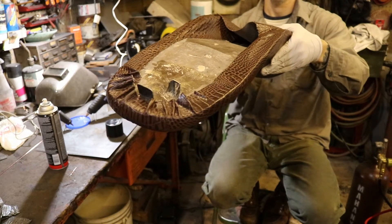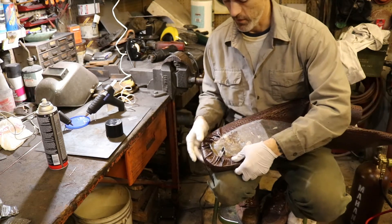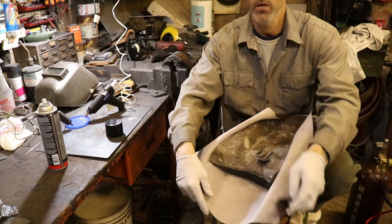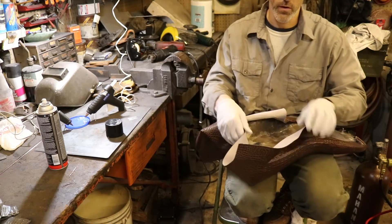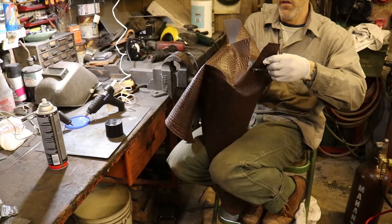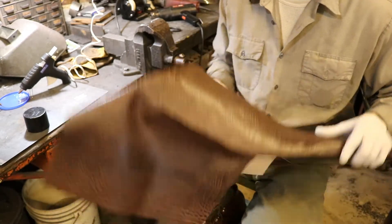There's the whole thing in the back. Hopefully that sticks and stays. My plan is to trim off the little pleats, apply more glue if needed, and that's it — that section is done. Moving on to the front, which has a U-shape curve going in. I'm going to need a relief cut right in there. If I cut a little flap out in the middle, it should get somewhere. I've managed to get this stuff stretched pretty good so it will form fit, then trim off the excess so it fits closer.